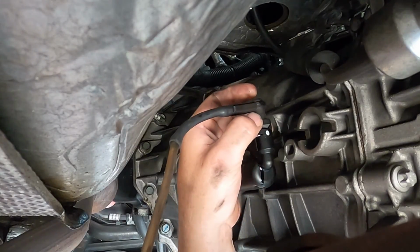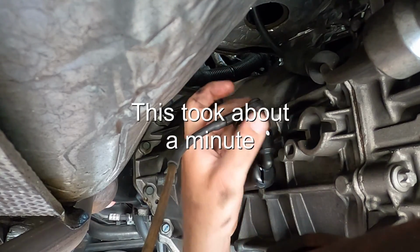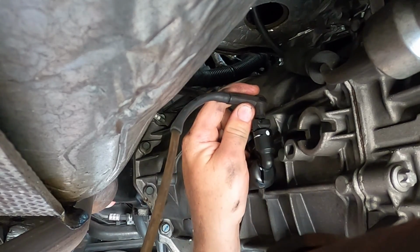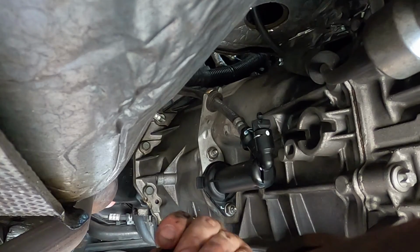So at this point, I have a really steady stream of fluid coming through, brake fluid. So I'm going to close my bleeder off and then disconnect my vacuum pump. And from there, then we'll do one more manual bleed.